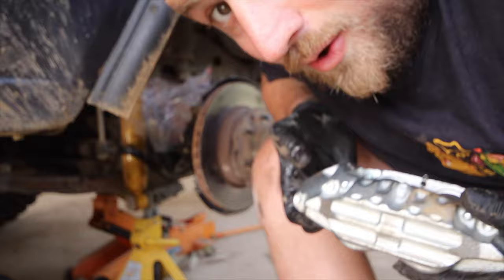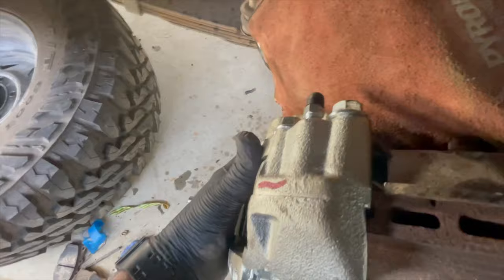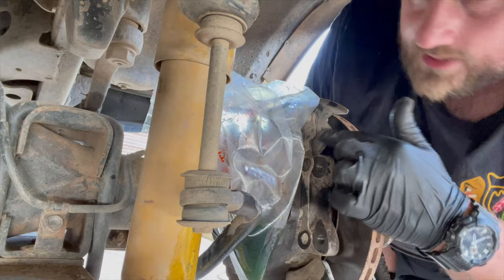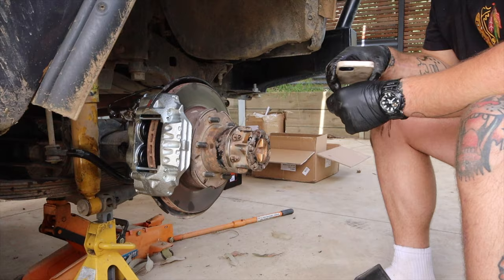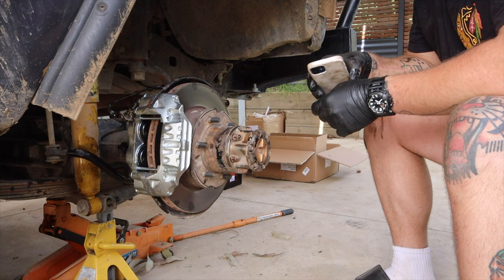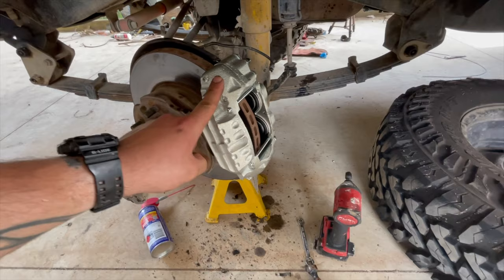That's pretty much on and it just touches it. We're taking off about five millimetres of this and this. This one's going to go on one-handed just like that, and we've got plenty of clearance. This was an incredibly easy thing to do - just way too easy. I'm not going to show you the other side, I'm just going to do it. The other thing I'm going to mention is I will be torquing these down to about 90 foot-pounds. That was what I found online, so that's what it's going to get.